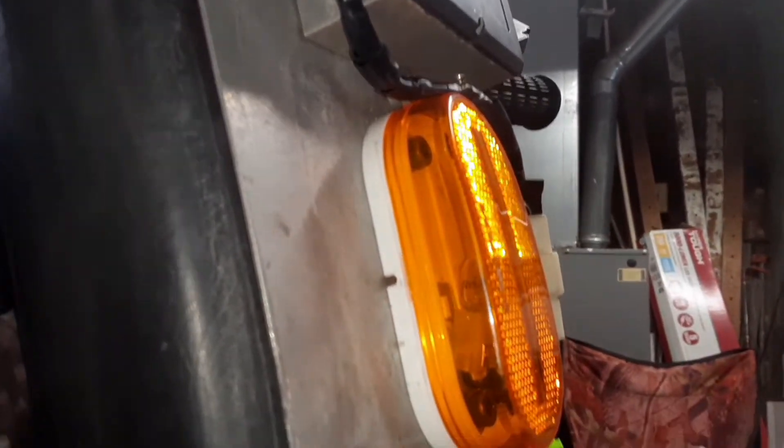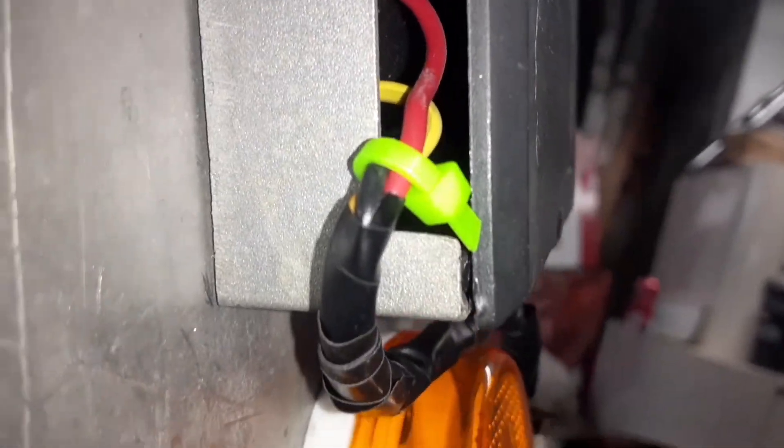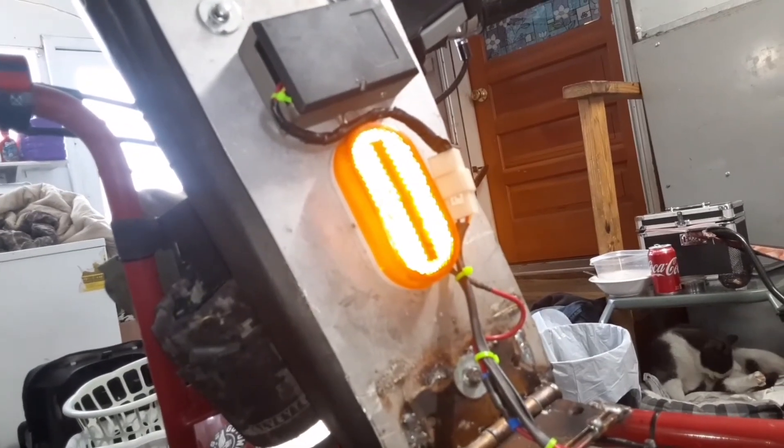This is going to be a good addition to the bike — instead of idling and only producing 8 volts, it's going to produce 14 and a half everywhere and hopefully charge my battery better. If you need more power out of your charging system and the power is just not consistent, or there's no regulator altogether, I highly recommend getting one. Thanks for watching and I'll see you in the next one.